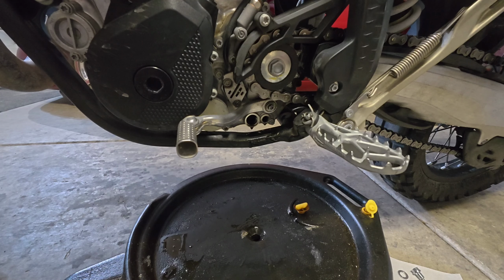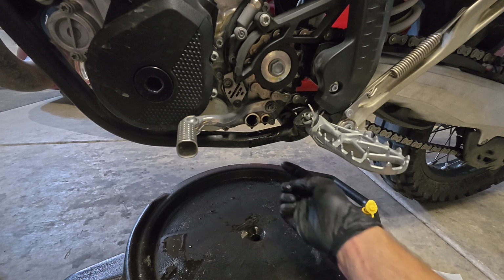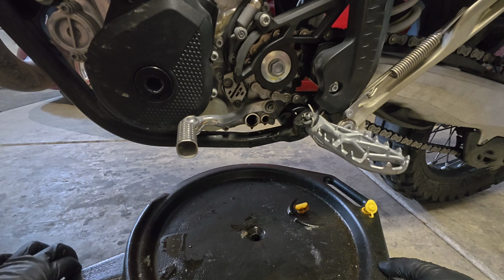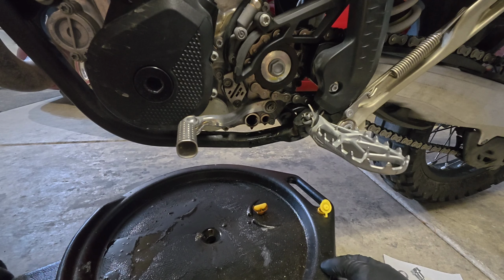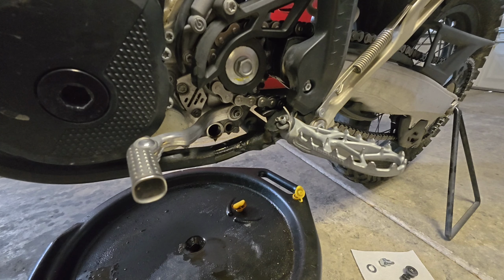Another thing is, you could move on to your oil filter cap at this point and continue to let it drain. But as I stated, for the purpose of this video and following the procedure in the manual, I will get the three plugs installed and then I will do the cap. But you could, for simplicity, shift your catch basin over a little bit, do your oil filter cap, let everything drip for 4 or 5 minutes, and then reinstall.